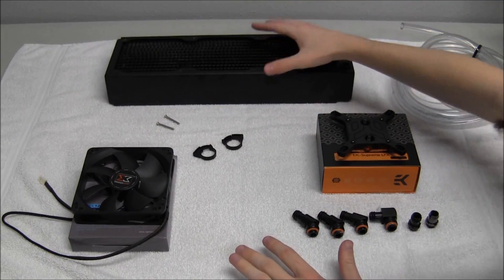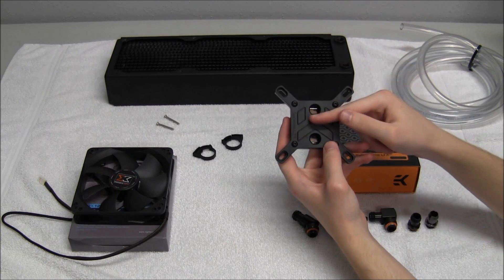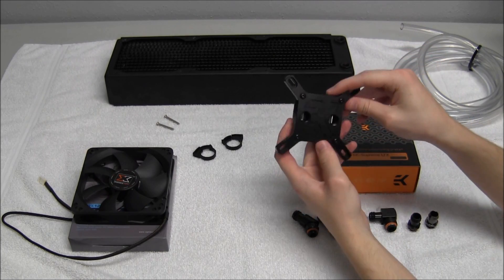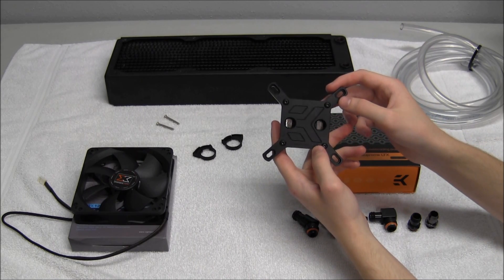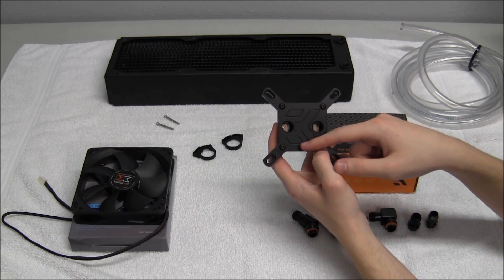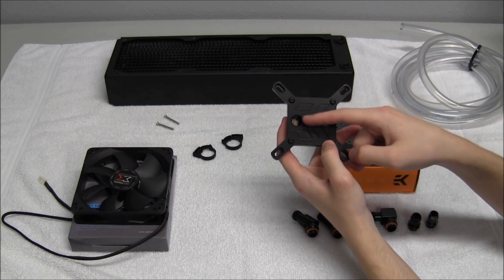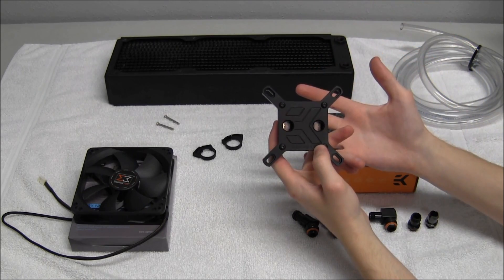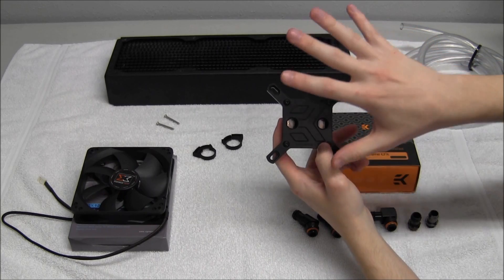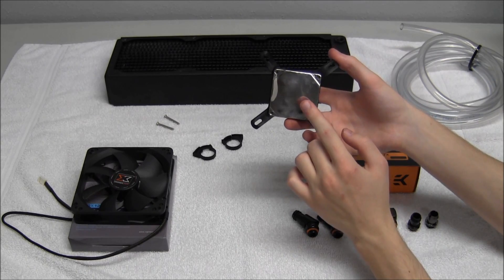Moving on, you have your water blocks. You need to get the water block that fits your CPU type. This is for socket 1155 and cools a 2600K rig — it's the low-flow block from EK. Honestly, the difference between low-flow and high-flow is minimal; you see no real difference in performance. You have your inlet and outlet — cool water goes into the inlet, runs through the channels, dissipates heat, and comes out the outlet. This comes with a backplate that installs on your motherboard, with screws and springs to keep the block pressed onto your CPU. Make sure you still use thermal grease on your CPU for proper contact.